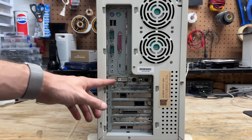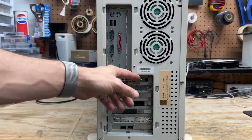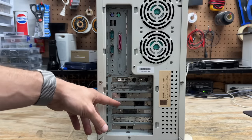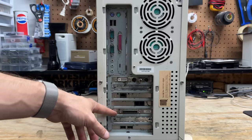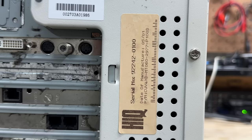Got an interesting looking video card there with RF output — I haven't seen that very often right on the video card. That's going to be interesting. And we've got our NIC here, got a dial-up modem, an additional parallel port — no doubt used for a sentinel key or something. And some extra USB ports. This system was manufactured in May 2001, so this could be a Pentium 3 or early Pentium 4 board, unless it's been upgraded. Let's get this thing open and find out.